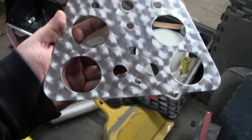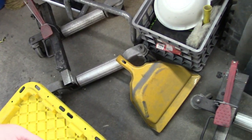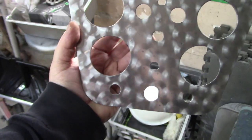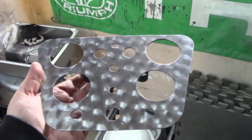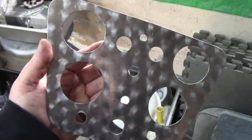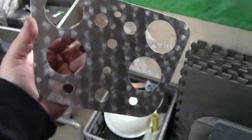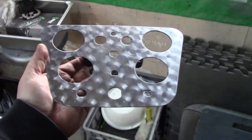This is the bottom and that is the top. I think that might be okay. Once we get some clear on it, we'll get the clear sanded down and polished, and hopefully that will pick up a little bit of the reflectivity in the light. I think that might be good. Let's move on to the next step and we'll break the clear coat out.